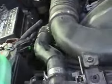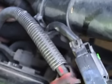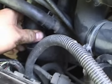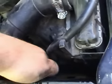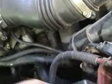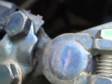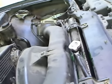Now if you want to see if it's too hot to open, as I said, there's a pipe down the bottom coming off the engine. You don't grab it near the engine. The engine's going to be hot on its own. You're going to put your hand down. This is all going to be hot. If it's been a couple of hours, it shouldn't be too hot, so be careful about burning yourself. And you're going to grab the pipe at the bottom. And if the pipe is really hot, don't open up the top.